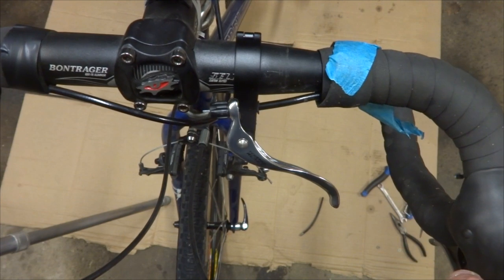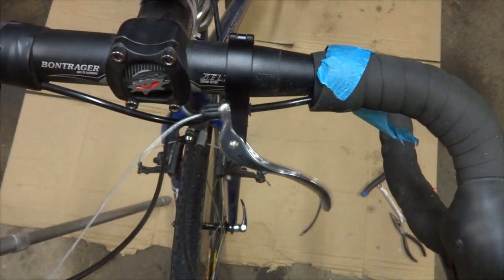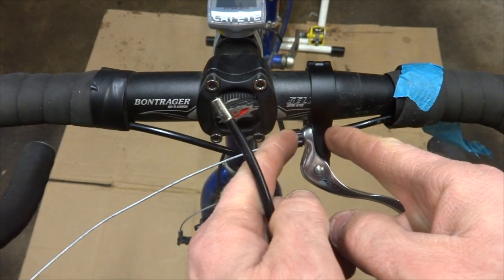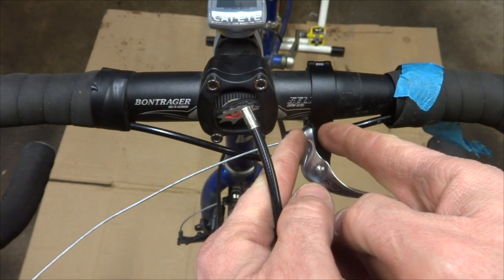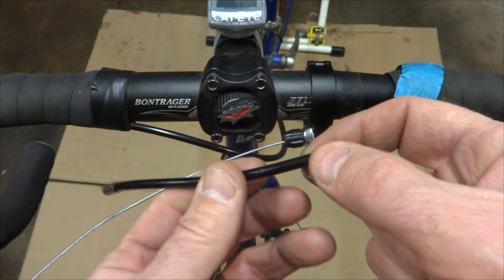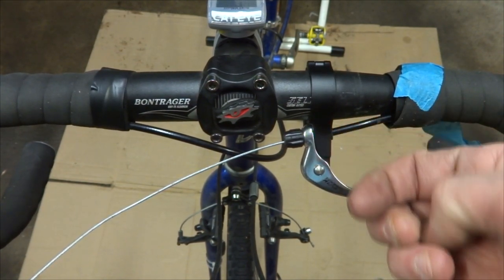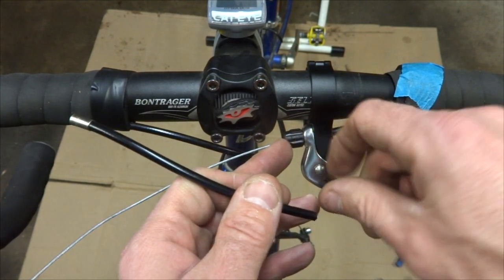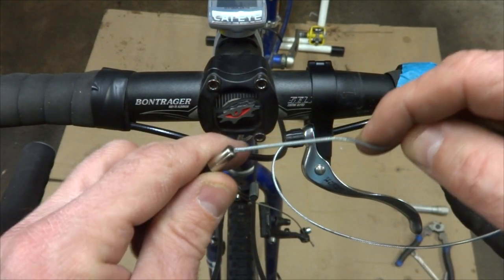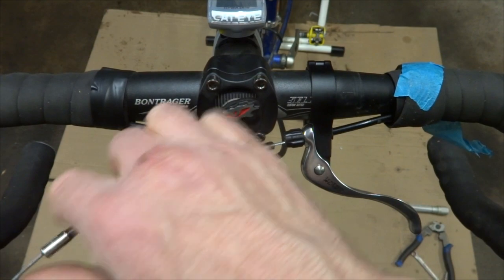Push the cable through, and when you get a partial grip you pull it through. Now I'm ready to hook up the remaining little bit of cable housing that I cut off. The brake lever itself is going to take up a little bit of space that the housing occupied, so in some cases you might want to trim a little off. On the side going into the brake lever I didn't need a ferrule, but here at the barrel adjuster I am going to need one. I'll slide the ferrule under the bit of housing, slide the cable through, and pull everything into position.